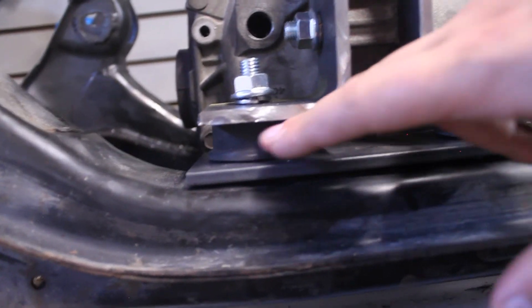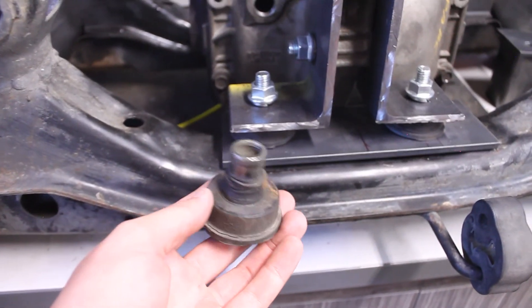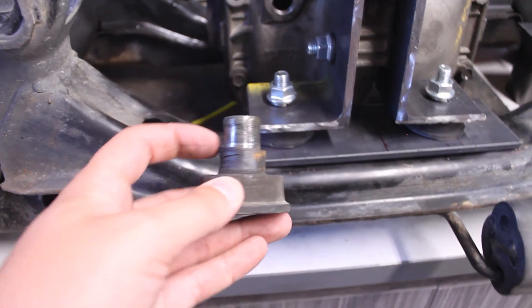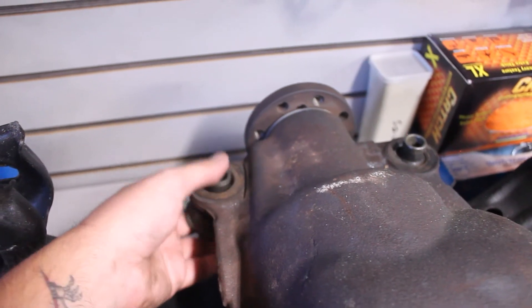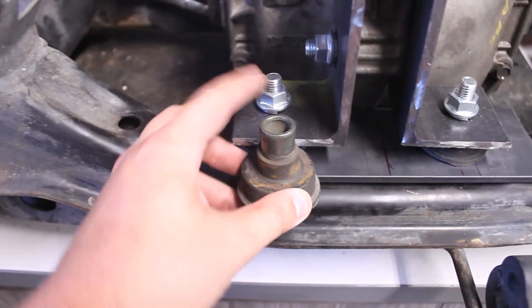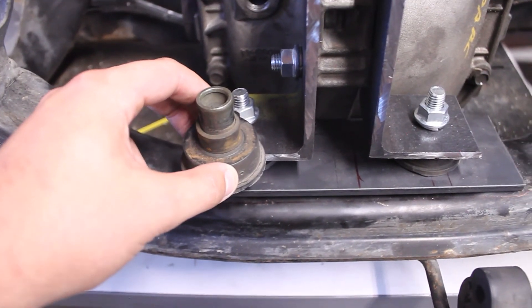You can see kind of how it works - the bolts go up all the way through the subframe, through this plate that'll get welded. This is just part of one of the bushings from the front, not very tight right now. It goes through the L bracket and then a nut and a washer. I'm going to order Energy Suspension polyurethane bushings - probably two sets for the front. I'll make the holes in this a little bigger to fit them, and I'll need longer bolts, but it should be nice and solid without being completely solid.